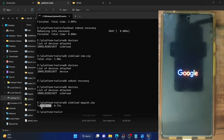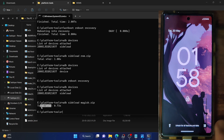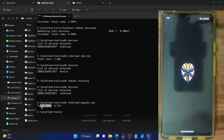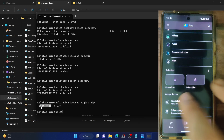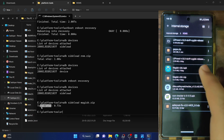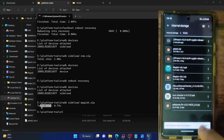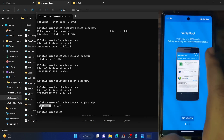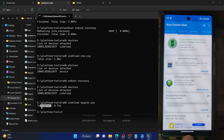Let's wait for the phone to boot to the OS and verify that root has been obtained. The boot up might take a few additional seconds — that's completely normal. Once booted, unlock your phone and launch the Magisk app. As you can see, our phone stands rooted and both the Magisk zip and Magisk app show the latest build. To verify root, install the Root Checker app from the Play Store. Open it, skip the initial setup, tap on verify root, and grant the Magisk permission request — our phone is now rooted by Magisk.